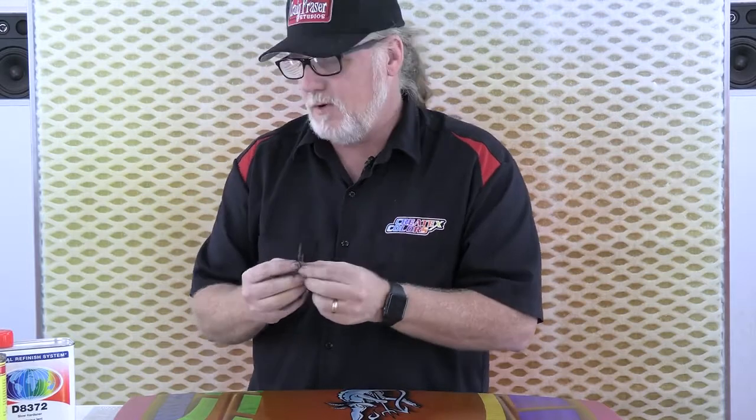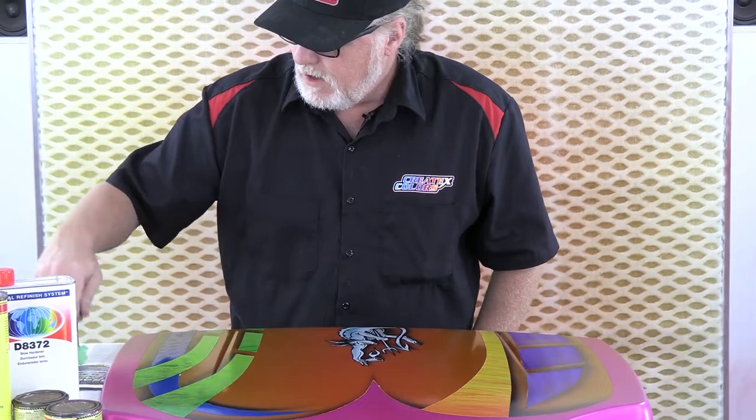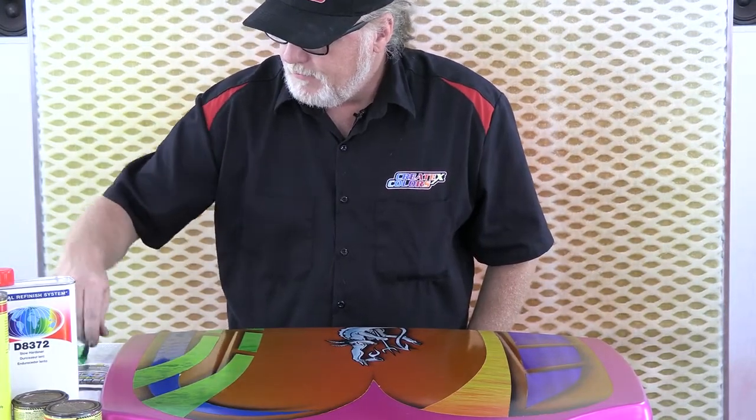If you're a left-hander, your pointer finger goes there. So this stick is always facing left because you can tell this is the blade, the part you're striping with, but when this is covered in paint, you can't tell which side is which. So always remember, flat side to your left. I'm going to dip it in some reducer first, then I dip it in the paint, and I palette it back and forth on the magazine.